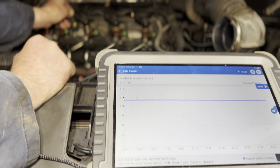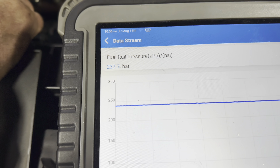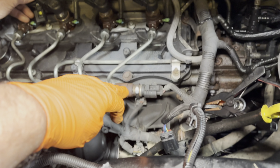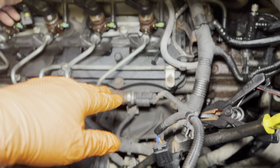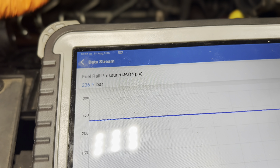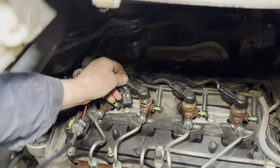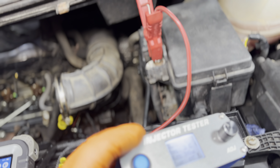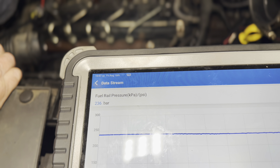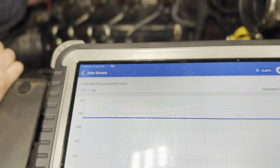Here's something unusual we're trying. We can't even work this out. The car's cranked over and we can build up pressure no bother at all — sitting at 237 bar. There's a fuel rail pressure sensor there; if we disconnect it, it defaults to 2000 bar, so that rail pressure sensor is good. If we open the injector the pressure plummets. We're pulsing the injector with the gizmo, and to me that pressure should plummet — and it ain't. There's no flow through these injectors, and that's the problem.